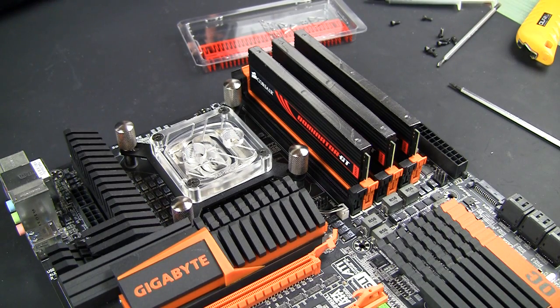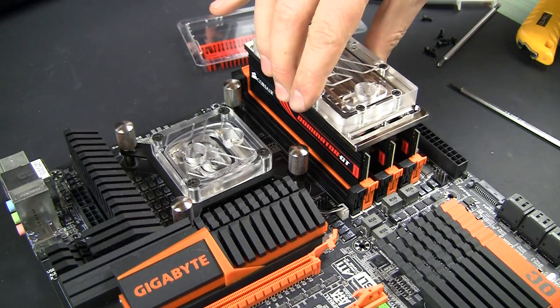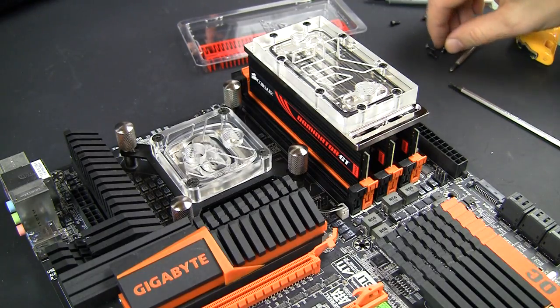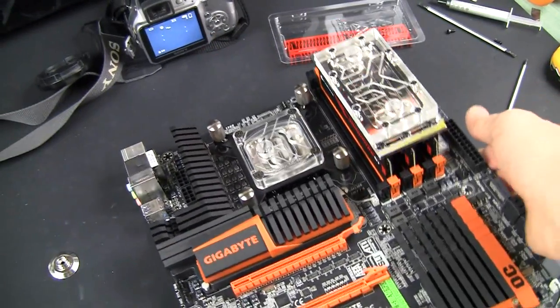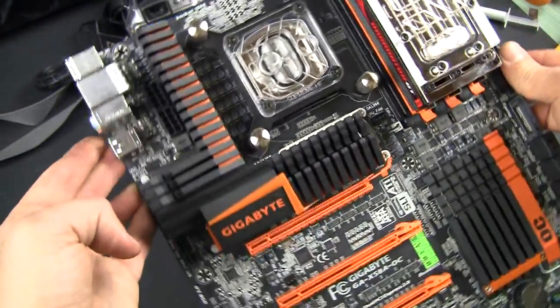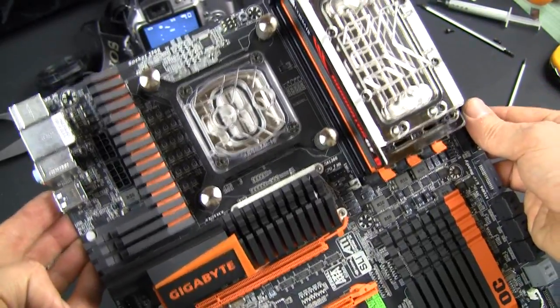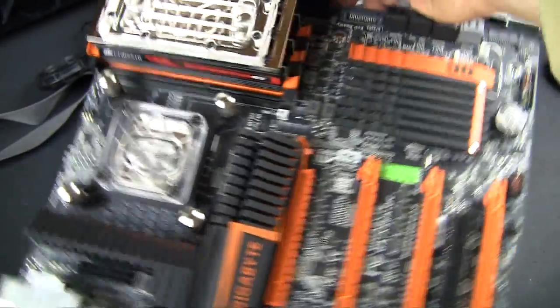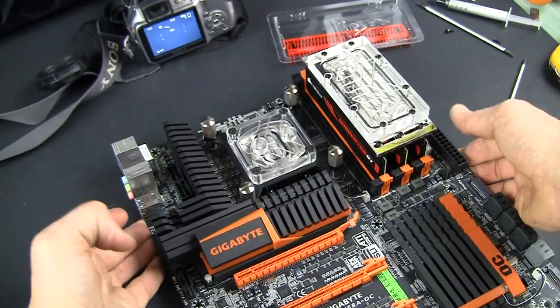All you need is just to put the block on and screw it. We'll see — if it works really badly we'll put thermal paste, but my gut feeling is that this thing will work just fine. So we put this thing on and put all six screws back. We have the final result: two blocks installed. A motherboard block is not available here at all, so it's not even an option. I have two of those and I just need to mount the whole assembly into the case.